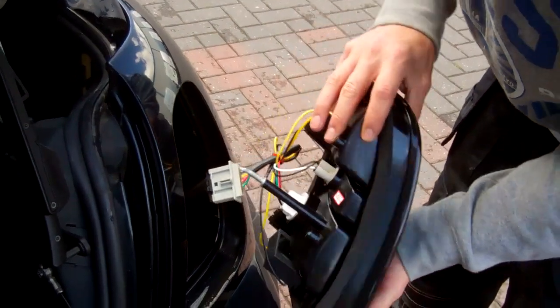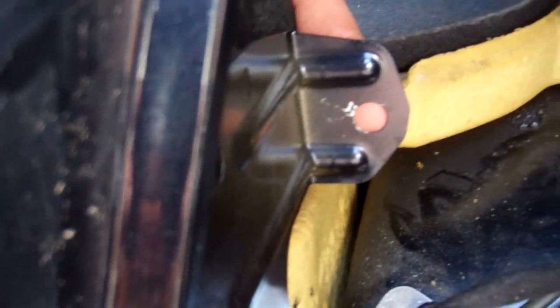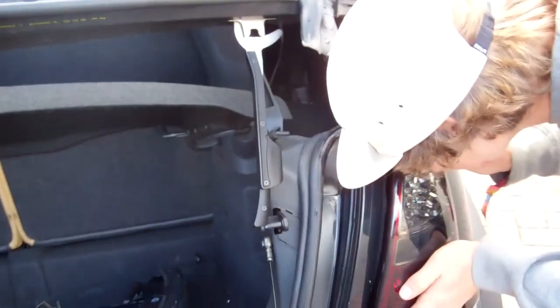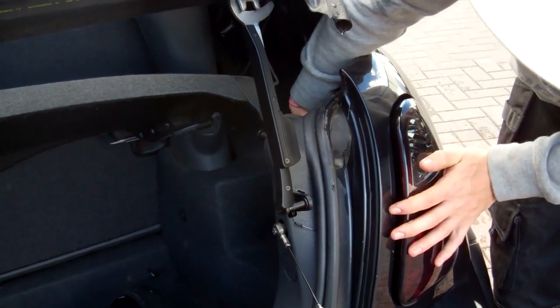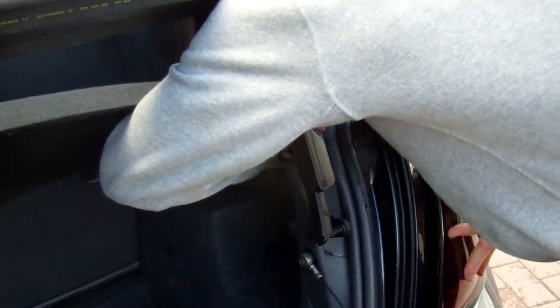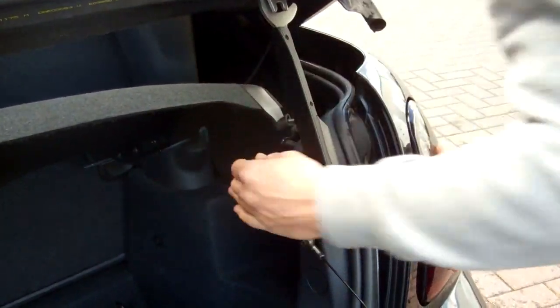Click that into the connector. Now you've got to make sure — if I just point that out from the back — you've got this little area here, you've got to make sure that you aim the stud for that little hole in that little metal bracket there. When I did the other one, I could feel from the back where the stud was going, feel the hole, get it in — because the clips on the side sort of try and force it over, but you've got a little bit of flex in that mount at the back.